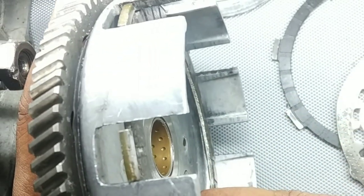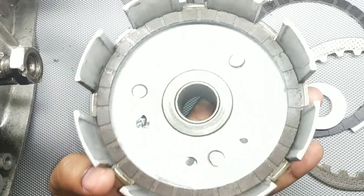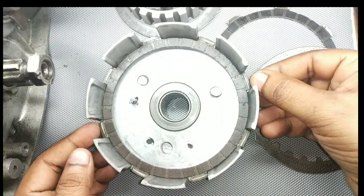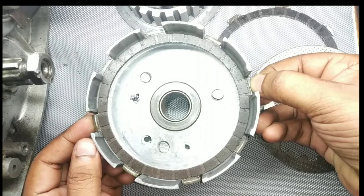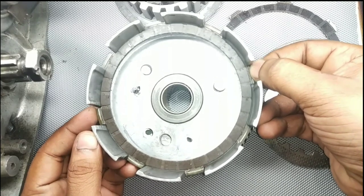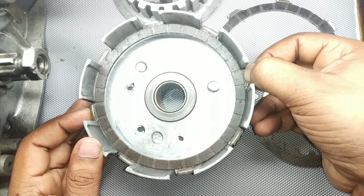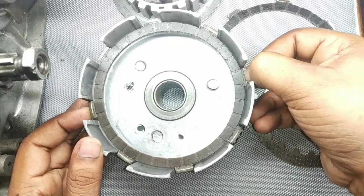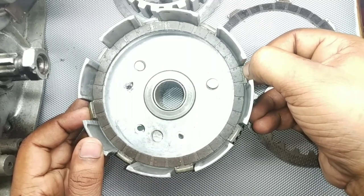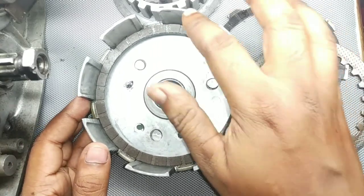On each of the grooves you will be able to see there is a large gap. So what will happen once you fit this on your motorcycle with such a gap — your clutch will keep moving, and that movement is what causes the sound. As the RPM of the engine gets higher, this will make a continuous noise.